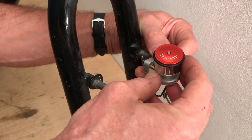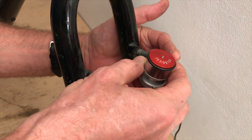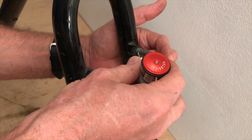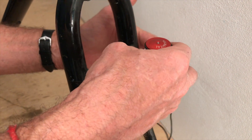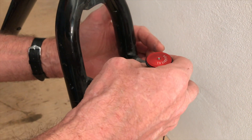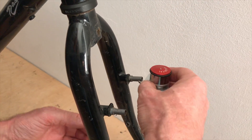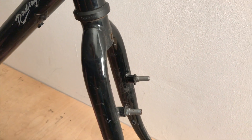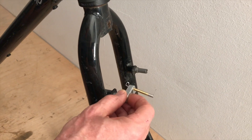The dynamo would sit about here. In cases where the bike has a hydraulic rim brake, we mostly find a lever on the brake which interferes with the installation of the dynamo. Especially if you have a Magura hydraulic brake, forget the left holder and please opt for the brake socket holder on the right.